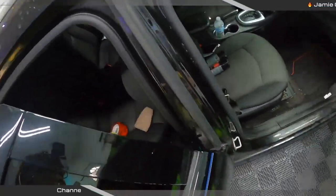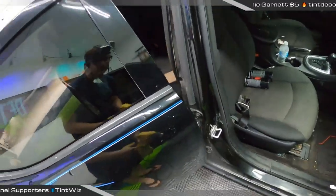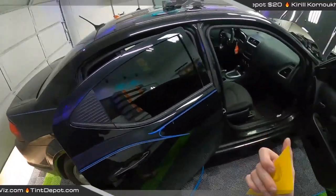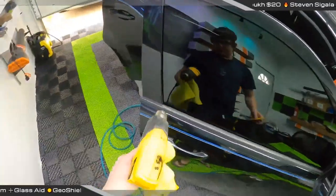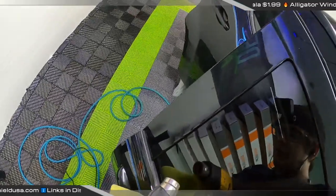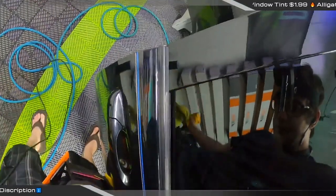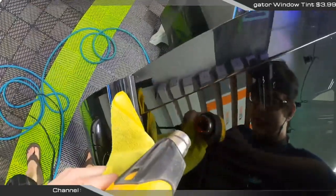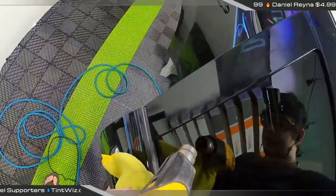And that's on a door that's really, really tight. And these are older. So comparing this to something that's newer, you're not gonna have as hard defined of a line there at all. And they're just gonna be little guys to press out, if you have them at all. Sometimes you do, sometimes you don't. We're doing limo on this, so I can't even see where my tri-edge is. But yeah, same thing. Heat it up, press it out.